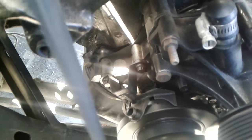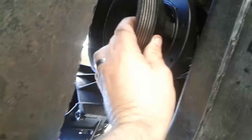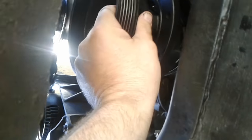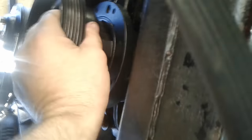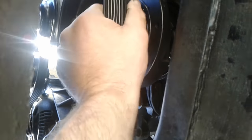I'm going to take it off. I just took the belt off — look how loose that crank pulley is. I don't know, hopefully I haven't jacked up my crankshaft. I can't pull it out, but look at that — the whole thing is just loose on there. Holy shit, it's throwing the timing all off.